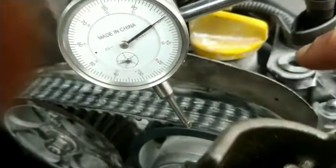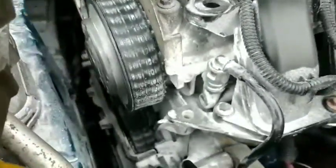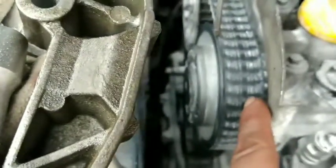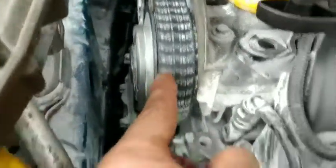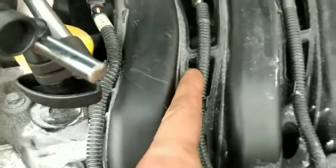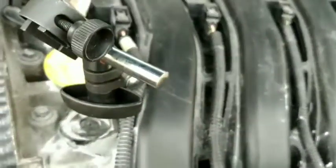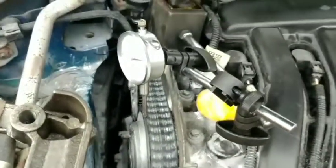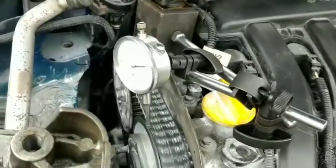This belt broke when I bought the car — well, before I bought it, it had a broken belt. So I'm wondering now if it's bent the end of the camshaft when the valves all broke. Because the camshaft's hollow for the oil to feed through to the end of it, and depending on which side of the phaser pulley it's on, it's high-pressure oil driven by an oil pump inside the head, driven by the cam. And it's coming out of there, but if there's ten thou of warp on there, I think I'm not going to fix this unless I get a new camshaft.